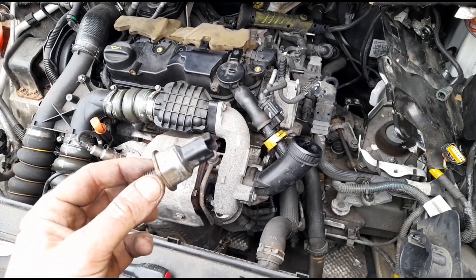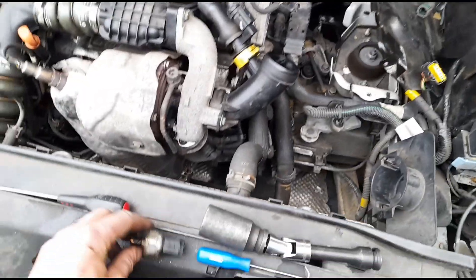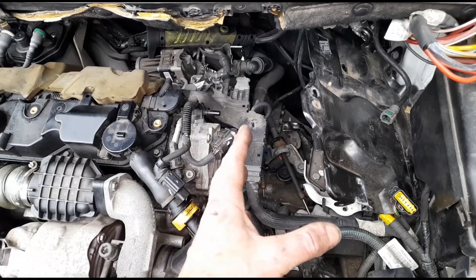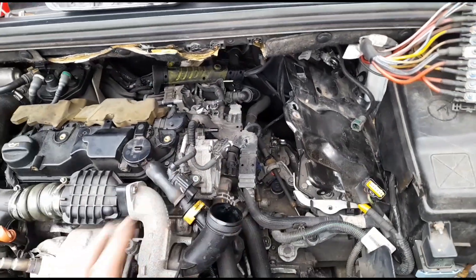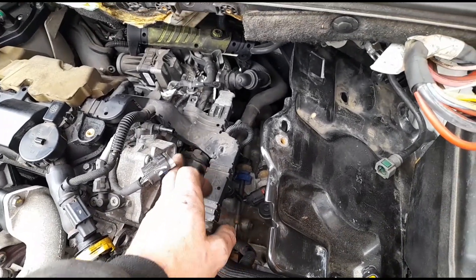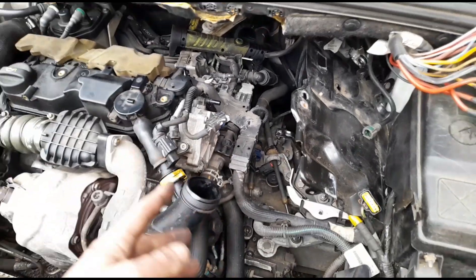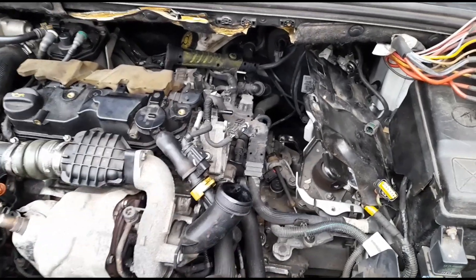It's probably taken me about half an hour, and to be honest it is fiddly. It's up to you if you want to do it this way — you'll have less on your mind if you remove all the parts — but I really don't want to lose all that coolant. When you remove stuff like the water pump or EGR, you're probably going to find the gasket on the thermostat housing is no good, so I'd rather just do it this way.